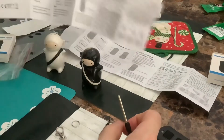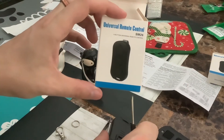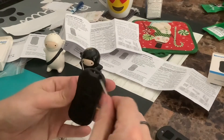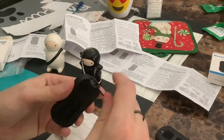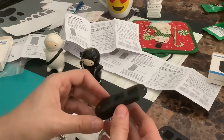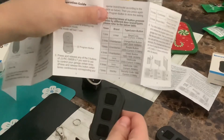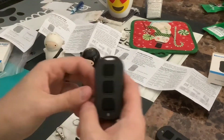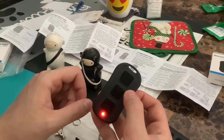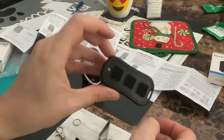This is a CR2016 top battery for this universal remote control SM26 — from Amazon, about 14 bucks. Remove the clip to access the program button. Go to your garage door, look at the learn button and note its color — mine is purple. The instruction says for purple, press three times. Hold the program button until the light is solid. It's red, not blue, but that's okay — press the button three times: one, two, three, then press the program button.